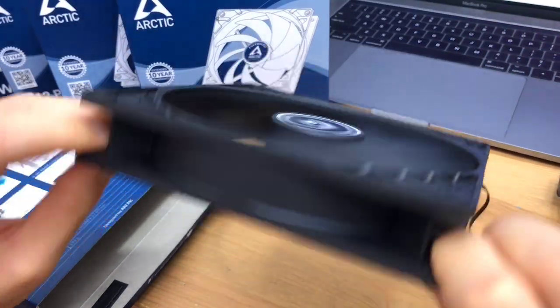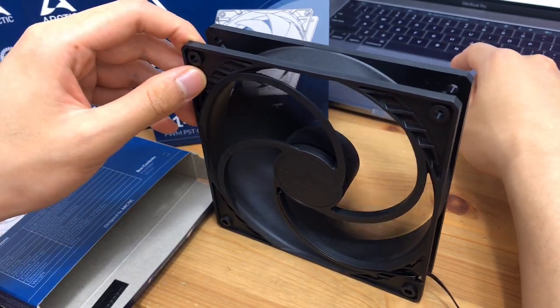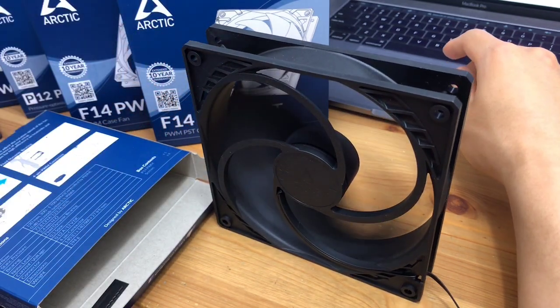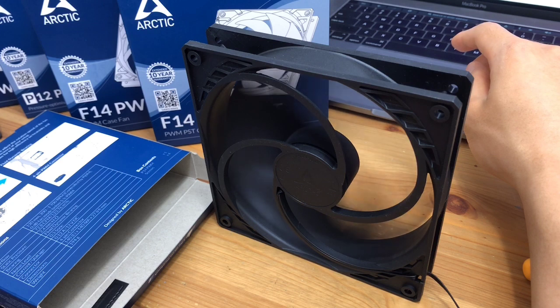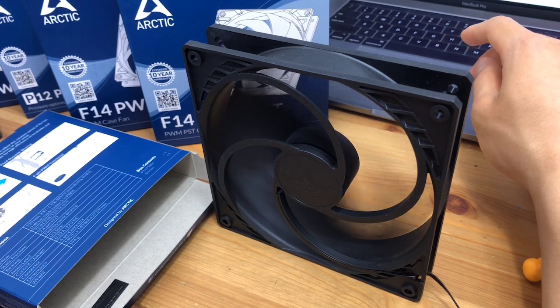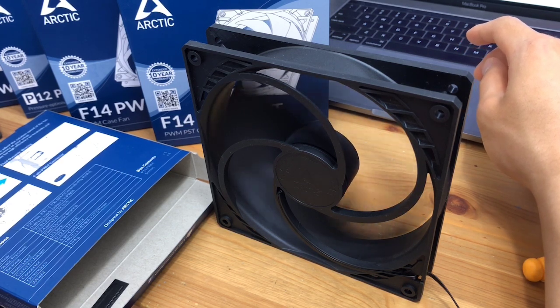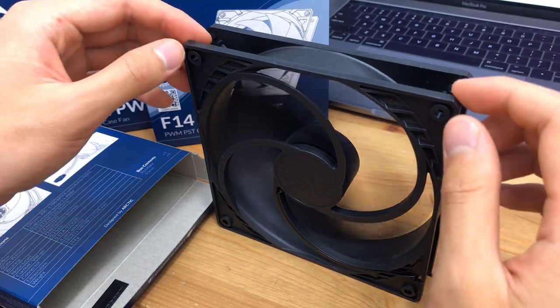so Arctic claims that the quote operating sound of the new Arctic motor is barely noticeable. Due to a sinus magnetizing, the new motor creates only about 5% of the vibration from commutation of a regular DC motor without filter. So there is no need for rubber spacers due to the steady and smooth torque of the new motor.